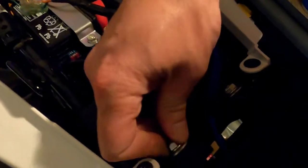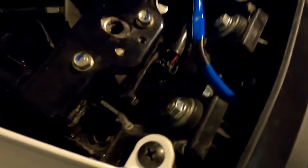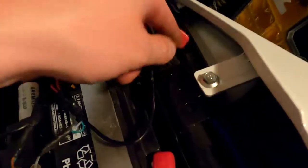Just like we said, it was the four, and that piece just comes off. And for the taillight, that's actually pretty easy. It's these two 10 millimeter nuts, they come off. Taillight comes out, unplugs, blah blah blah. So it actually probably plugs in up here somewhere. We'll have to figure that out when we go.